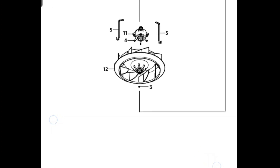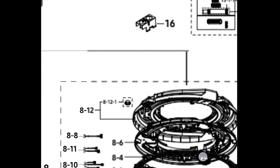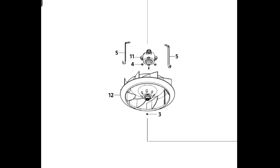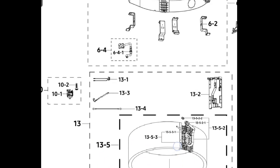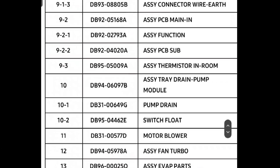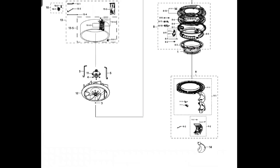Here's an example of the exploded parts view. You can see item 5 which is the brackets, and item 11 which is the motor. If you want to find the condensate pump, item 10-2 is the float and 10-1 is the condensate pump. Go down to where it says 10-1 pump drain — the part number is DB3100649G. You'll write that on your invoice, call your distributor, give them the part number, and they'll be able to call Samsung and get the part.